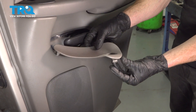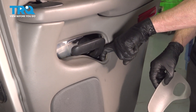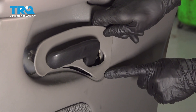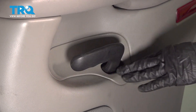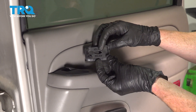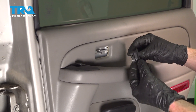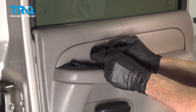Now we can continue on with our trim panel. You'll find along the bottom area of this, you have a small hook that needs to fit in behind the door panel. Grab onto that door handle, give it a little tug and slide this right on through. Now we'll bring this area down — that's that little hooked area — and we can press this into position. Now we can put on our door lock switch. You'll find along the backside of this you have a hole — that's where the door lock rod needs to go into. So we'll make sure we're in the unlocked position by forcing this forward, bring the switch to the unlocked position as well, and then press this right in.